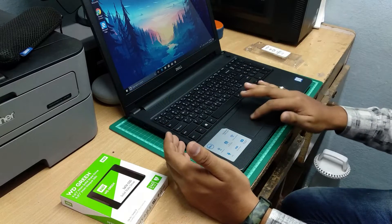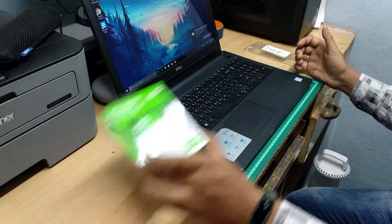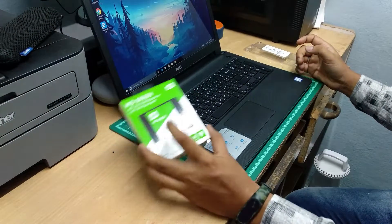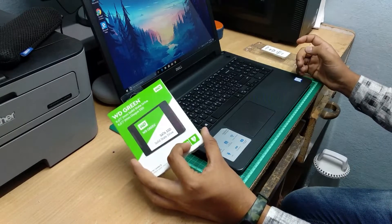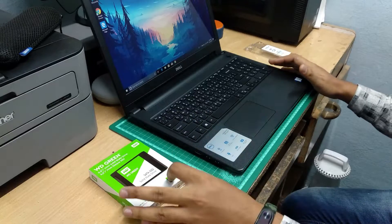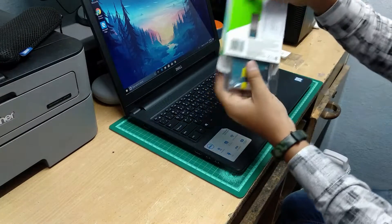The system gets much faster if you install this SSD. It's a good update. I suggest you install the 240GB SSD, not the 120GB, because this laptop only supports up to 240GB. My old hard disk is now retired.